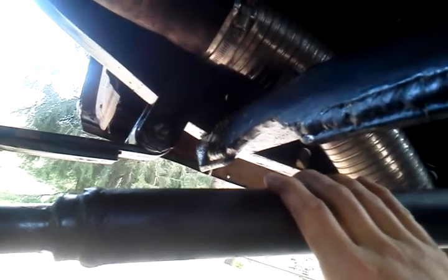And then I've got one right here that we put in ourselves, and it's a 3/8 inch piece of galvanized angle. I had to cut a piece out right there just to give it some clearance from the transmission. I beefed it up on the other side over here with another piece and welded that on there. And I cut out a little bit of a chunk right here just to give my drive shaft a little bit of play in case the body came down a little bit and the springs gave a little bit. But I beefed both of those up on top also, and just bolted it to the frame, and it goes up through there, right in here. It's not just right here.